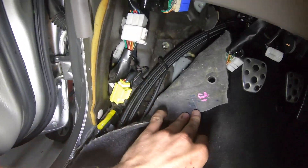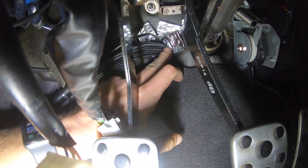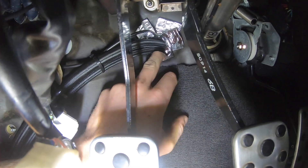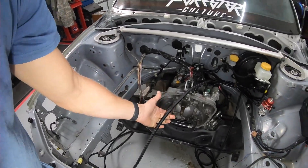As it goes up it goes right through here and under, through the firewall, and I do have kill mat sitting around there so it doesn't rub a hole in it. These are both lines — the 8AN feed and the 6AN return — so that is how we delivered the fuel to the front of the car. Some people say to route it underneath the car, but STIs typically come with a plate you can take off and secure the lines under the car. Foresters don't come with that, so routing in the stock interior location was the easiest option.